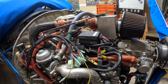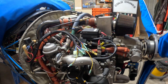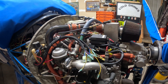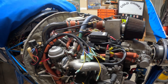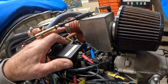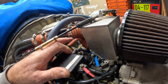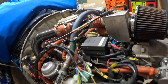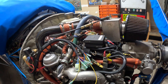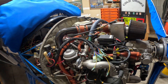More than that is the fact that it doesn't shut off clean all the time. When you're on floats coming into a dock and the engine doesn't shut off, it's kind of unnerving. It sort of ticks over almost like old cars in the 70s and 80s that ran on. The wires have been repaired down here close to the epoxy — I repaired them once when I got this thing 10 years ago and again this year, but there's no more wire left to repair. It's getting too close to the module. These are old modules — it's a 912 UL with four-pin modules and sure plugs.